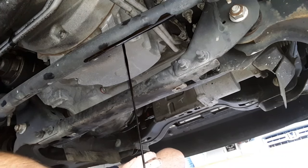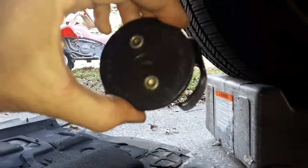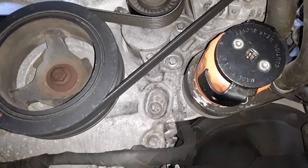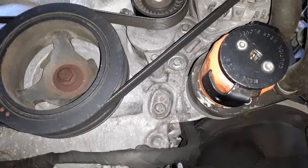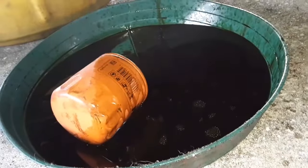We'll let this drain. I've got another small pan — we can go up front and work on the filter while this continues to drain. Here's my filter wrench — it just kind of expands and goes over the filter. I'll just get an extension and a 3/8ths and turn that off. Here's our filter. We took the filter down — nice easy spin off. Does make a little bit of a mess, but we'll hit that with some of the Amsoil brake parts cleaner. It helps to have a little secondary pan where you can let everything drain at the same time.